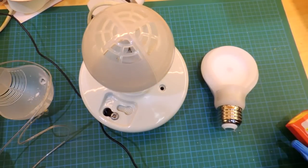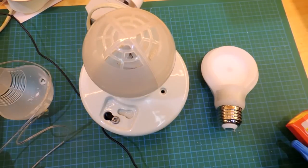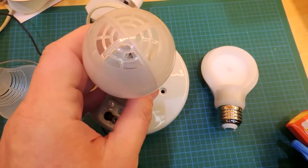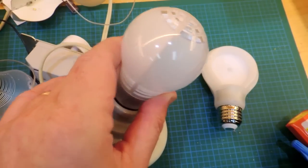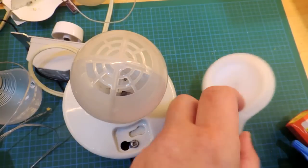So who's the winner — is it the Cree bulb or the Philips bulb? For my interests, they're very similar bulbs. I wouldn't use either in task lighting because I don't like the flicker, the noise when dimmed, or their relatively short lives. However, there's certainly an argument for them — especially when tossed on sale with utility rebates coming down to a couple dollars apiece. There are plenty of locations like utility closets where the bulb doesn't get used much, and that would be a good use for them. I like the Cree slightly better. I do like the manufacturing engineering demonstrated by this company — they seem very in-process. I also like, quite frankly, that it's more of a bulb-shaped product, whereas the Philips has a strange-looking shape.